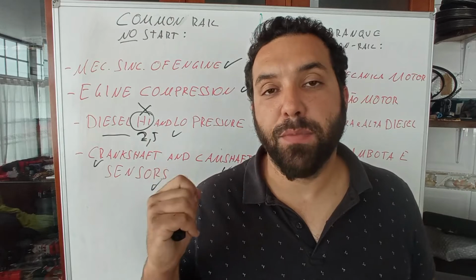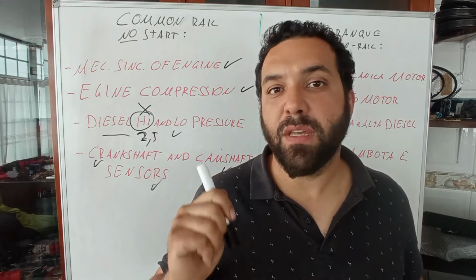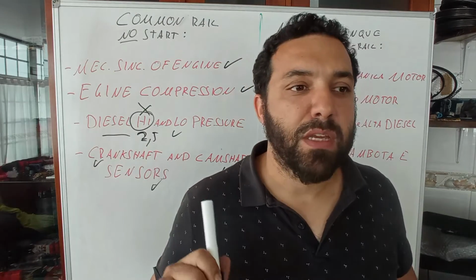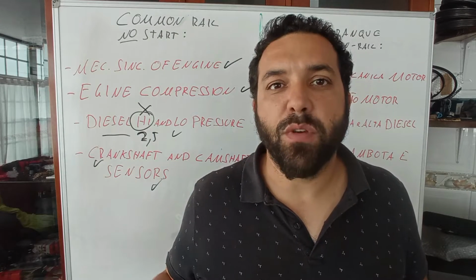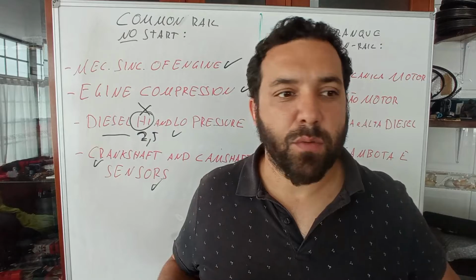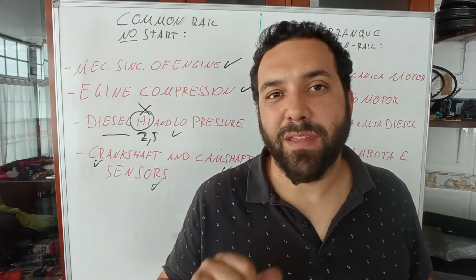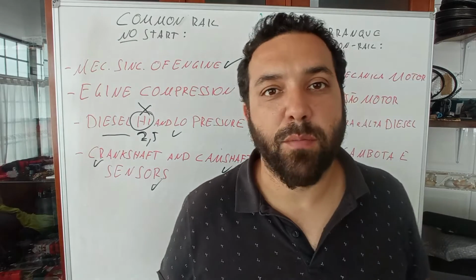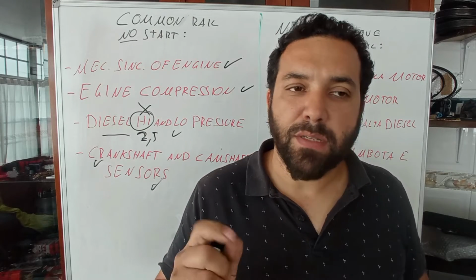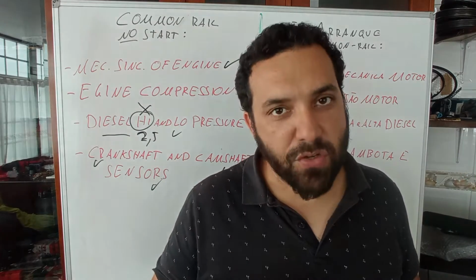What is important is that these high pressure fuel pumps, with age, are starting to have these issues. Very worn out inside, the shaft becomes worn out, but it's normal to have 20, 25, almost 30 years of working, and in the case of this car, almost 25. Obviously it will fail eventually, okay? But still, if you have good maintenance, namely on the fuel filter and using the additives and whatnot, because Alfa Romeo here in Portugal said every 20,000 kilometers when doing the maintenance at the dealership, we use an additive called Diesel Art. It's over there on that board that I showed you in previous videos, and the brand said to use it every 20,000 kilometers because it eliminates the water that is normally inside diesel. The water causes these issues on the high pressure fuel pumps, cavitation and whatnot.